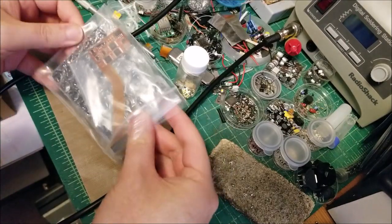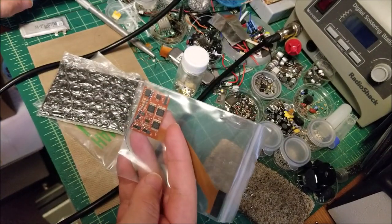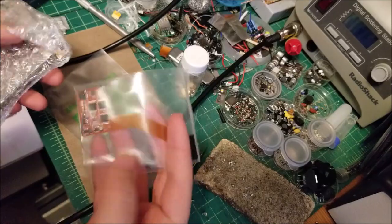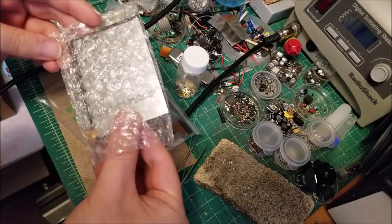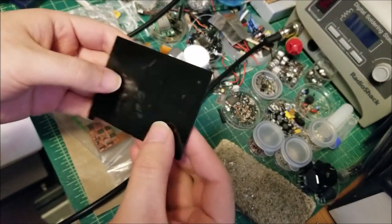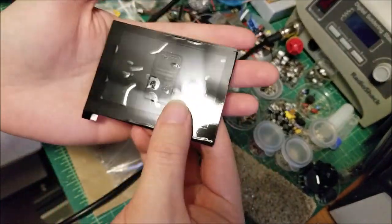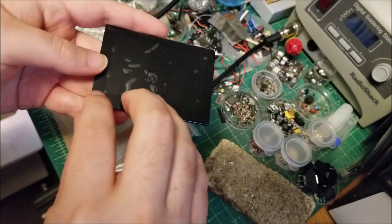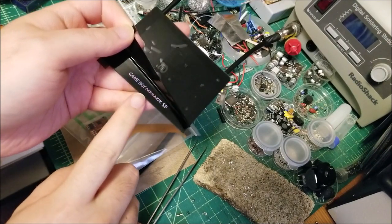Let's see what's included in the kit. We have the ribbon itself and one extra wire, which is probably for the brightness switch. There's no touch sensor on this model so it likely uses the original switch. The LCD is actually fused to the glass screen protector, which is convenient because you don't get dust in between. There's a nice overlay with a picture of a Game Boy Advance SP on it, and interestingly this one has the Game Boy Advance logo.